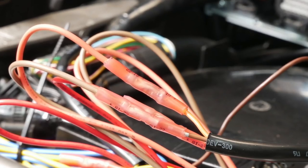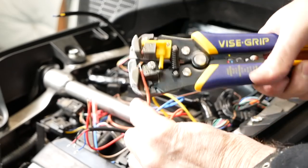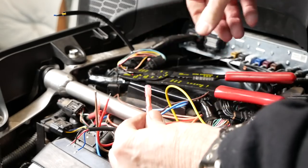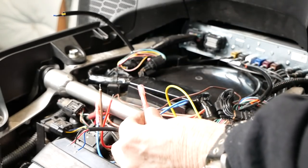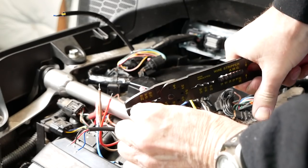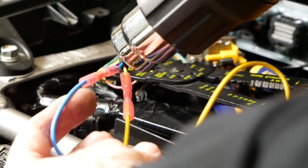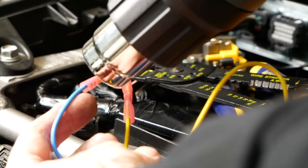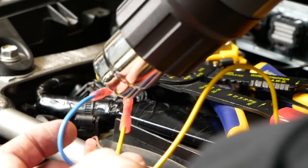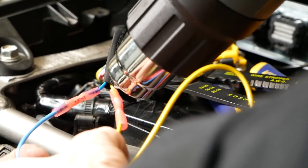I've always had better experience with these butt connectors than with wire splices, and that's why I chose to use these. Using butt connectors does require trimming wire from both sets of wires and then crimping the butt connector to each side. Remember, you're connecting like colors — yellow to yellow, blue to blue, red to red, and so on. Now I'm using a heat gun to shrink the heat shrink tubing on the butt connectors. This will give us a really good waterproof, watertight connection. I'll put a link in the description to where you can get these heat shrink butt connectors on Amazon.